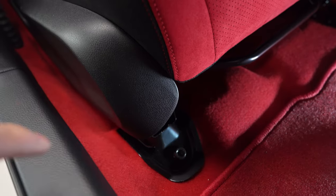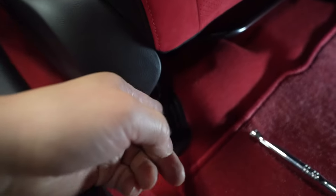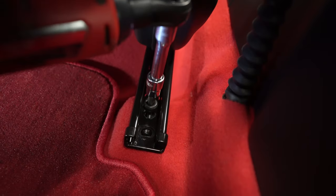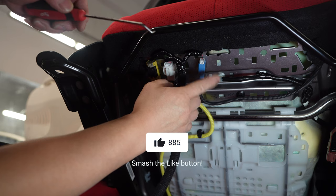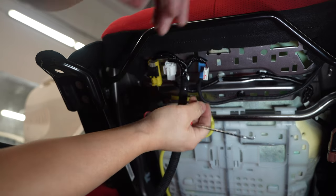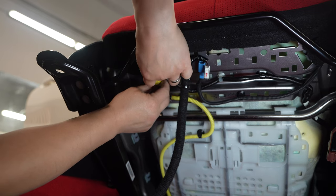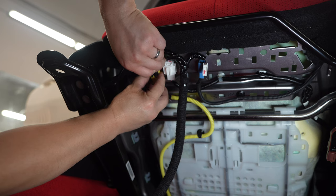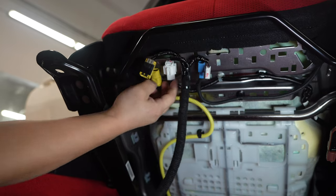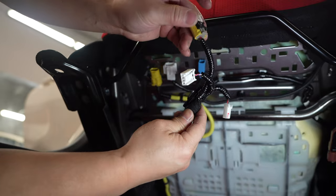Next up, we're going to take out the T-50s. They say online it's the T-50 — we're going to take all four of them out, unplug all the sensors, and then take the seat out. Now we have access to it. We're going to start unplugging the seatbelt — the seatbelt connector is blue. And this is the weight sensor, and this is the airbag connector. Pull forward and unplug. And unplug this one. It's all out — so seatbelt, airbag, and weight sensor.